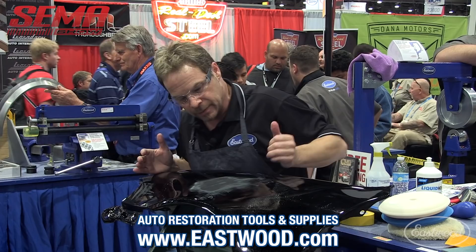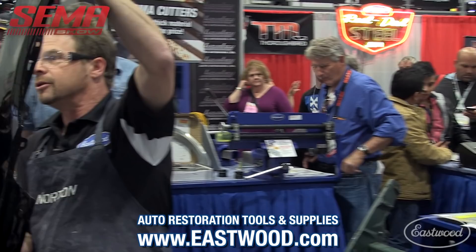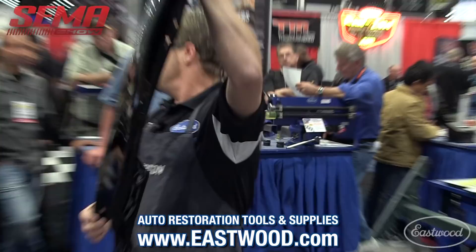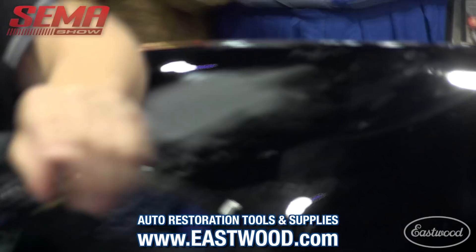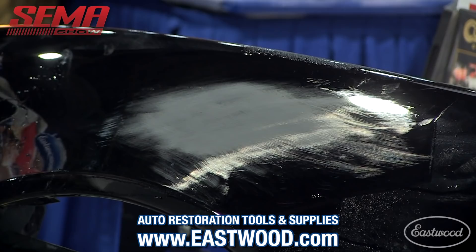We're at 1,000 grit — I'm reading the panel and I'm seeing a little bit of shiny stuff coming through that fender. It's dark, it's light, dark, light — we haven't gotten through that top layer, that hard skin, that M&M shell. We're still working on it, so we're going to keep blocking our clear.